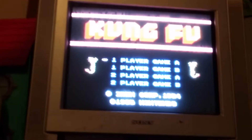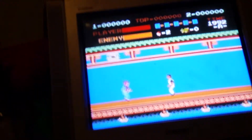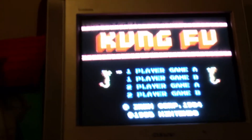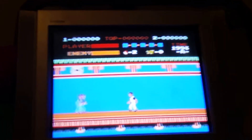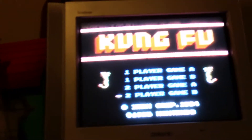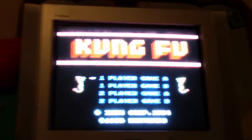Okay, so I'm back from wiping it out again and it's working totally fine. Usually they say to blow on the cartridge if it shows a blue screen or a red screen or if it blinks. I wouldn't recommend doing that. I would recommend just wiping it out with Windex so you don't hurt your cartridge. Whenever you see that red screen, just wipe out your games and it'll work just fine.